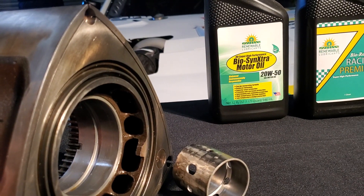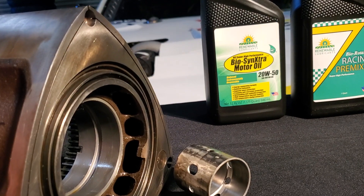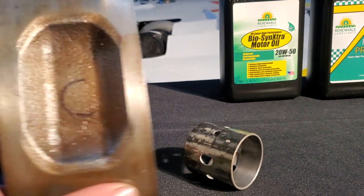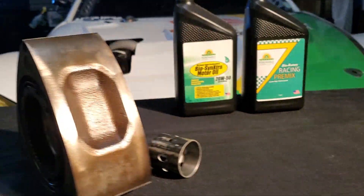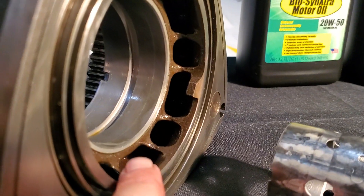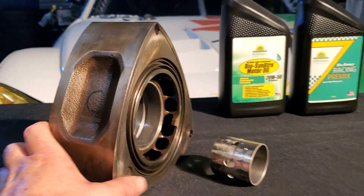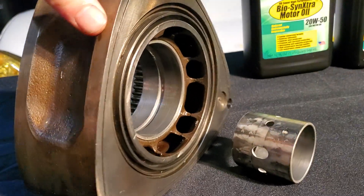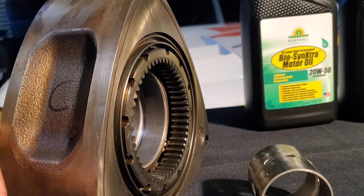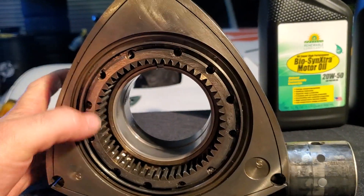For over two years — close to three years — we've been using the Biosyn Extra motor oil from Renewable Lubricants. I'm running the 20-50 RCR. They just did some testing recently with Richard Childress Racing, comparing Renewable Lubricants products to Mobil 1 products, which I think speaks volumes. If you look inside my motor, I would absolutely agree — this is some of the best bearing wear I've seen in a long time out of a competition motor. Absolutely no babbitt anywhere, and that's after two years of thousand-horsepower dyno days, practice days, competition days, and huge heat changes.